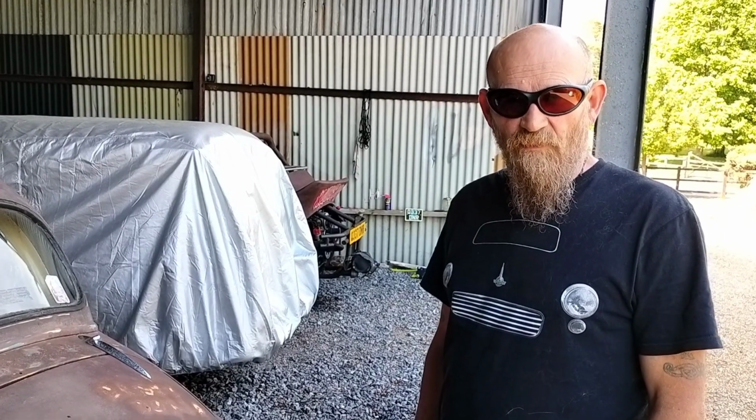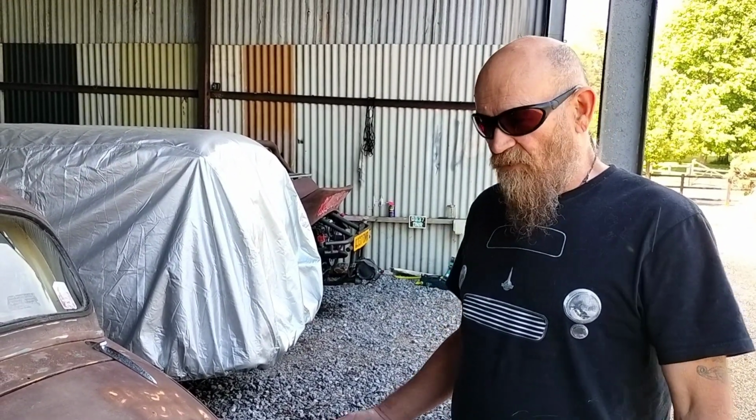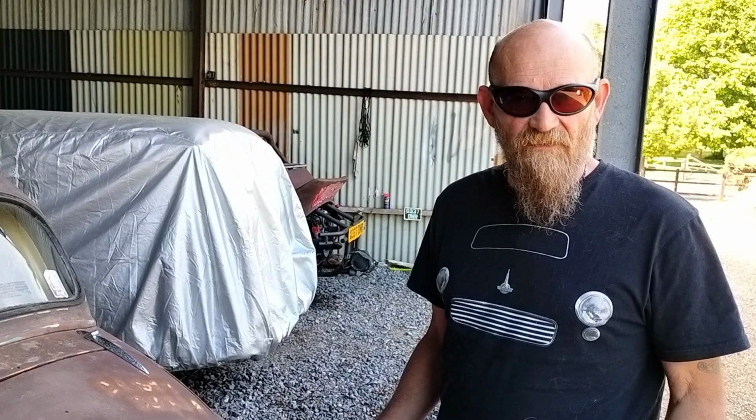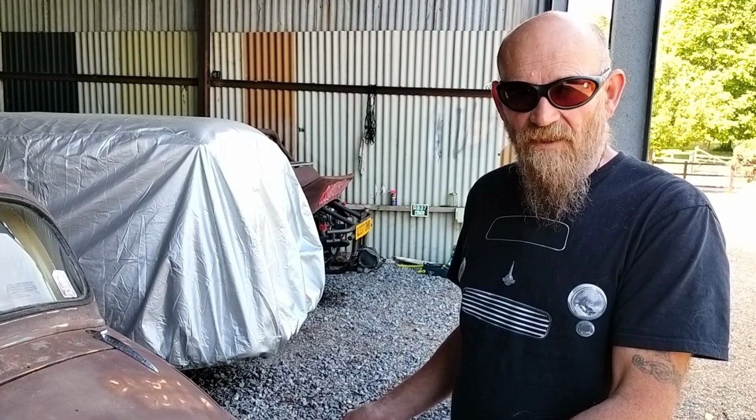So why would you put telescopic damper conversion on your Morris? We've got two Morrises, they're exactly the same, they've got 5 leaf springs, polybush conversion, and they're brand new, so it's a good way of showing you what the difference between one and the other is. This one has got the telescopic rear damper conversion kit on it, and our old South African white Morris over there has got the original lever on damper conversion kit on it.